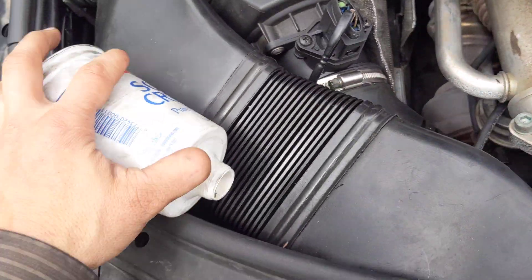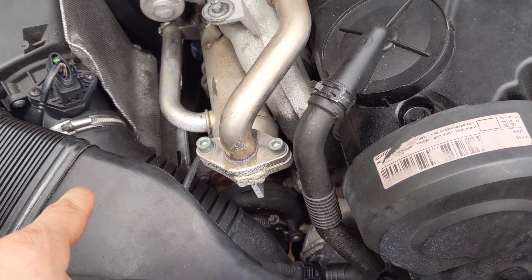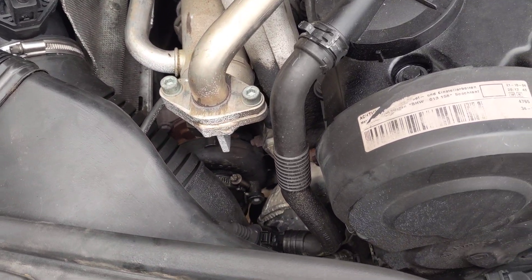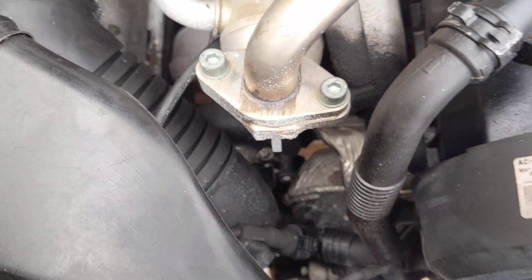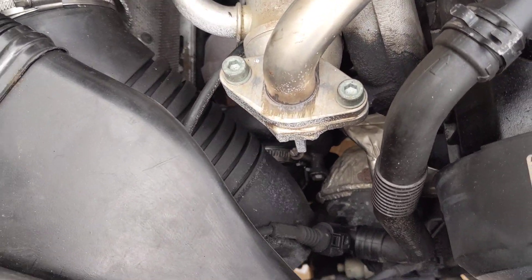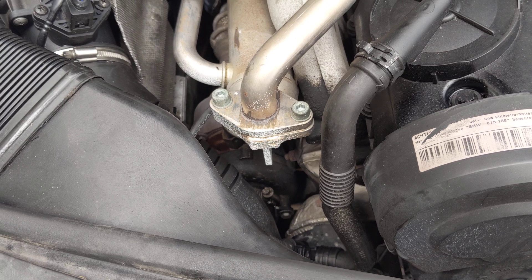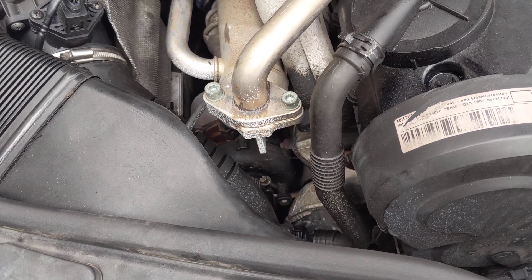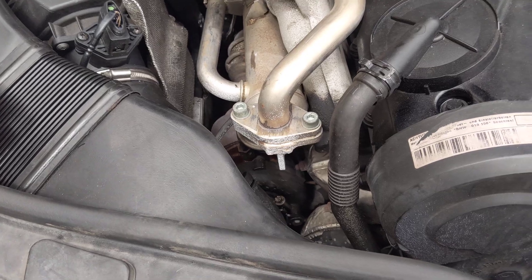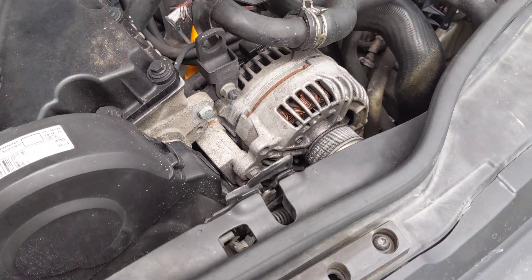I'm making this video to give you a shortcut on how I did it and what the problem was. These o-rings can go bad - mine had basically been baked. This is a 15-year-old car, and being on the back end of the turbo on the exhaust inlet side, that aluminum heats up to probably 300-plus degrees. After hundreds or thousands of hours at that temperature it dried out and was letting a lot of air by. My code hasn't come back since the repair, although my VCDS readings are still not looking great, but the sensor code went away.